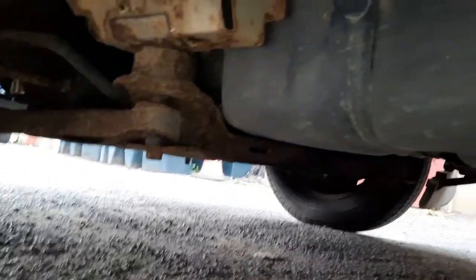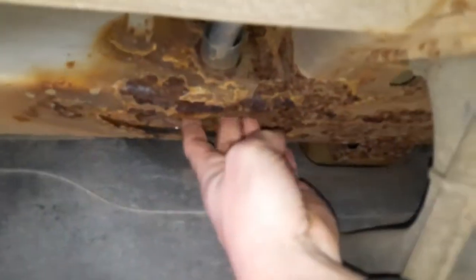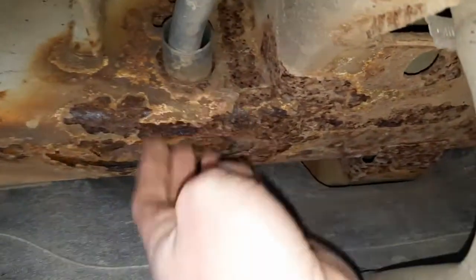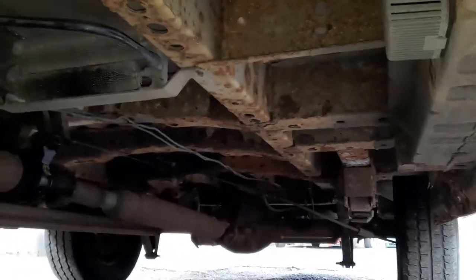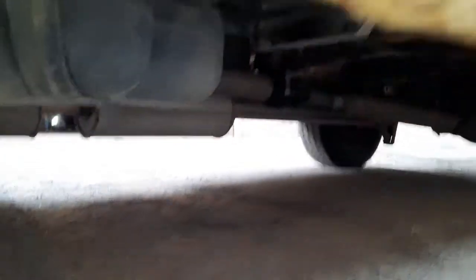Let's see what we've got under here — I'll give it a proper inspection once I'm welding it, but first things first is just to get it all welded up and nice and solid. Oh, there's a nasty big hole up there that'll need to be welded up, right next to the fuel tank. Put my finger in there. So I just have to go all over the chassis and make sure I've got all this welding work done. The welding bit's the most critical — the most important thing in a Transit. Engines and suspension and stuff like that are easy to swap out, but once the chassis is absolutely gone it makes it a lot more difficult.